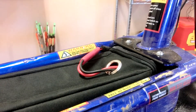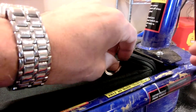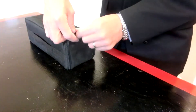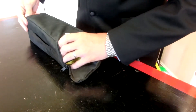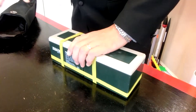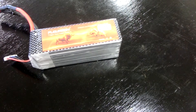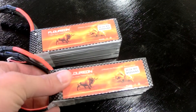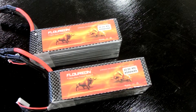You want to open it up and disconnect the battery pack. Inside is this huge heavy lead acid battery pack that no longer works. We have two giant batteries — they are 12 volts, 15 amp hours each, connected in series, which makes it 24 volts. We're going to substitute that with a couple of 6S batteries, which would give us 22.2 volts. These ones have 4500 milliamp hours, which is 4.5 amp hours. If we hook them up in parallel, they give us about 9 amp hours.